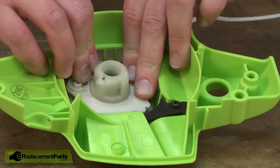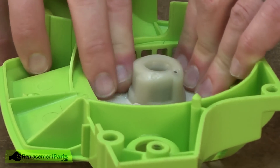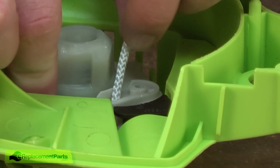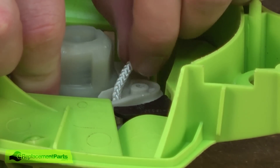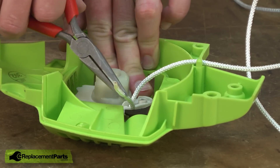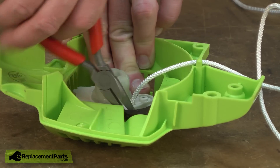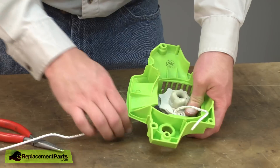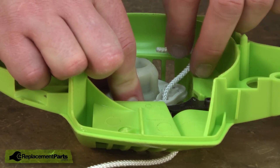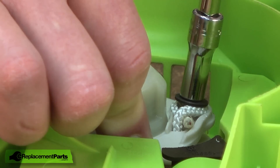Now what I need to do is rotate the pulley back around until the hole where the rope passes through lines up with the hole in the starter housing. With this design of starter, the easiest way to install the rope is to go through the hole in the pulley. Then I'll grab the rope with a pair of needle nose pliers and insert the rope through the hole in the starter housing. I'll pull all the rope through the two holes until I have just a short tag end of about two or three inches. Now I need to secure the rope to the pulley — I loop the rope around passing it underneath itself and then tuck it down into those shoulders. It'll hold it more securely and I'll secure it with the screw.